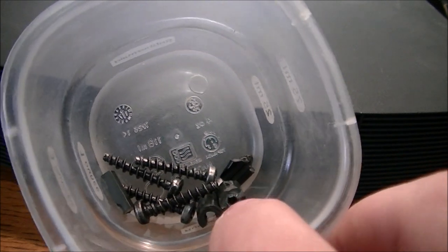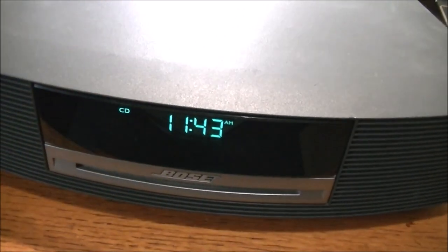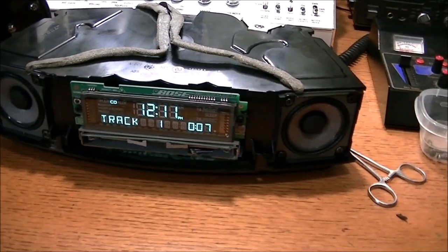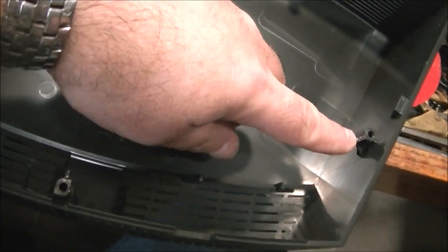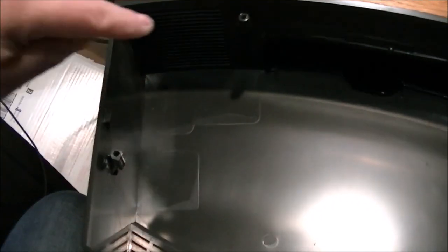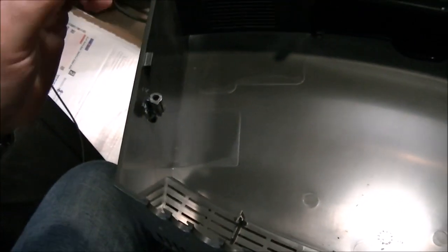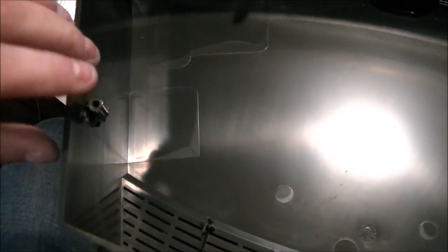I'm finishing up putting these little tabs in their respective places so the unit can be screwed down properly, top to bottom. I've let the CD player cool down again while working on the top part of the radio. This one here has been re-glued, this one was good, and this one has been re-glued. I just found one more small piece inside the radio that I neglected to find — it goes right here. Two tabs were good; this one was cracked and had to be glued, and this one was just ready to pull off, so I prepared it too.